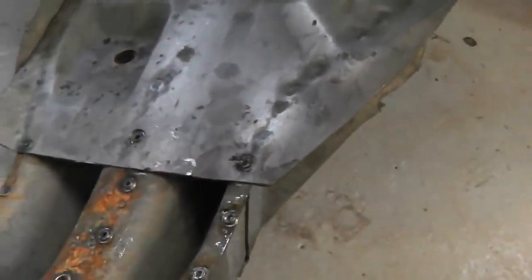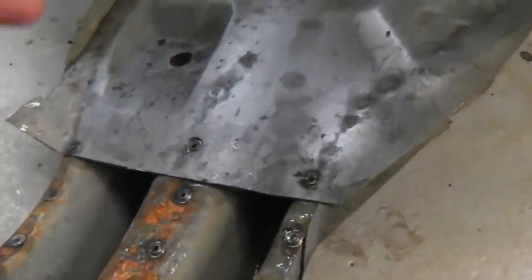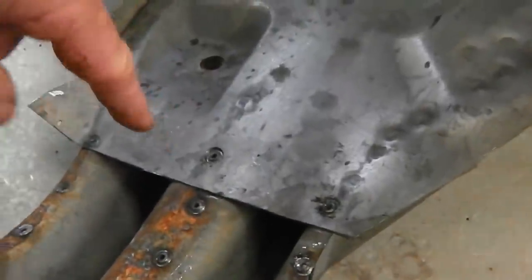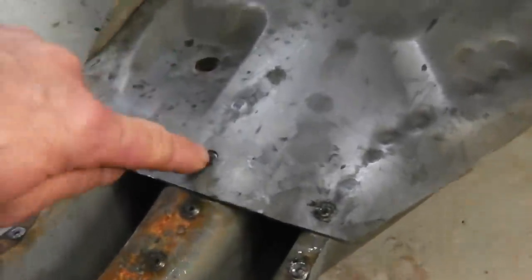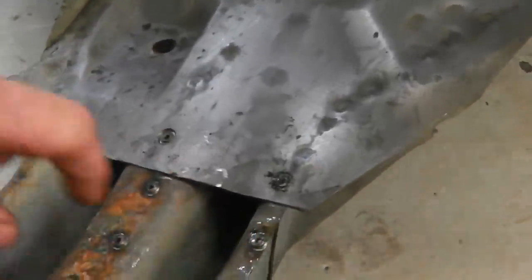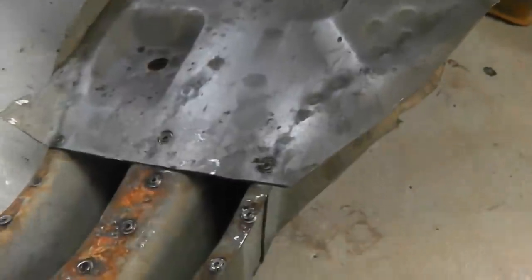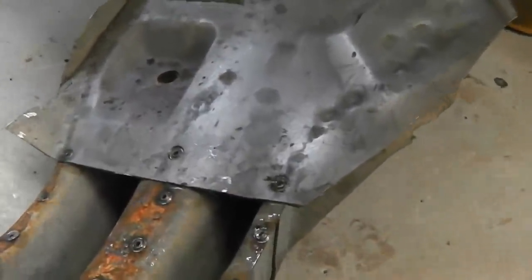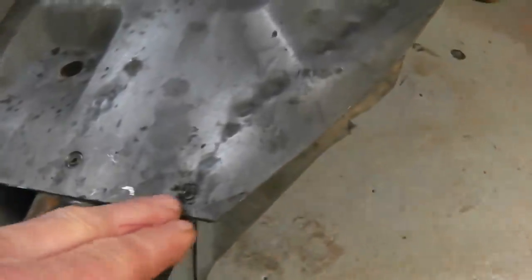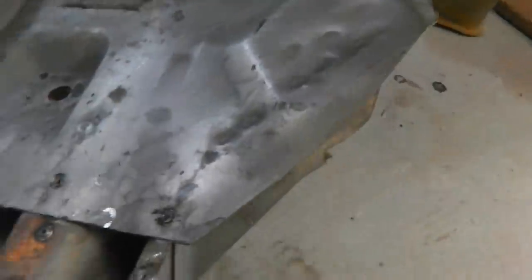Now what will happen is, when you do your drilling, it'll not ping every single one. They won't break away free. They're always holding on just a little bit, either because the hole saw's not gone deep enough in, or because you've just gone left of centre. However, if you get a good chisel, and you need a very thin chisel designed for splitting metal, so get yourself one of them. It's a good investment. Thin wedge chisel, then you start coming in this way, and you can lever this up and it'll ping as you go. And that's what I did this end.